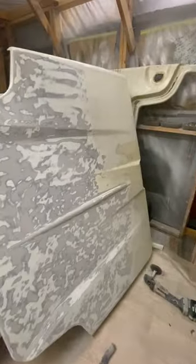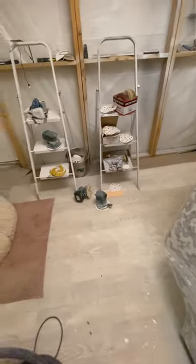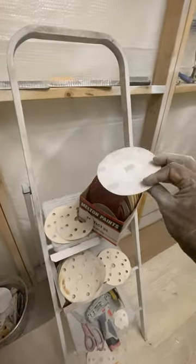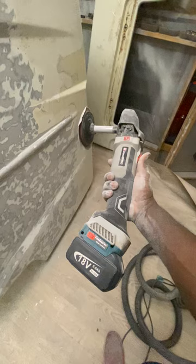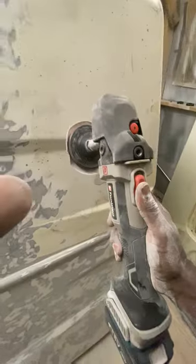Just doing the boot lid. These boot lids were quite badly oxidised and peeling, so there's a fair bit of work involved getting all those peeling marks off. I tried 180 but it was just too slow, so I grabbed some 80 grit — these are wood sanding discs — and used them on my homemade tool pro with the Makita battery rotary buffing tool with a little extension, and that worked quite well.